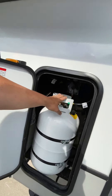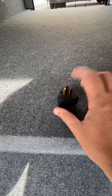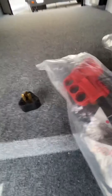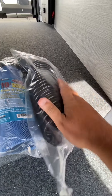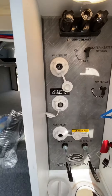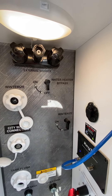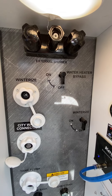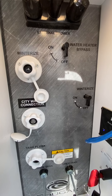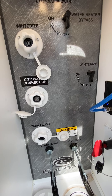Other 30-pound tank over here. Inside the pass-through storage here, you have your 30-to-15 adapter and also a 50-to-30 adapter. Sewer hose, and then this black coil hose is for the outside shower right here. You also have the winterize hot water bypass and winterize port — your antifreeze will be taken right where it says winterize. Below that is your city water connection for the hose, and then tank flush just below that for the black tank.